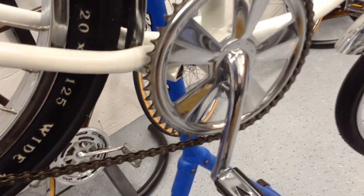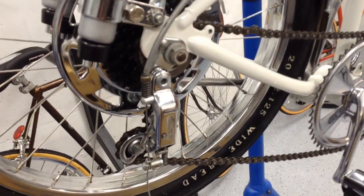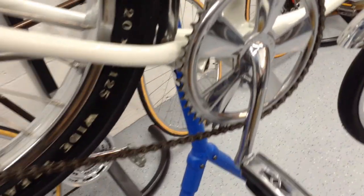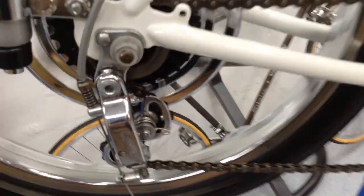When you put an extra layer of chrome on the teeth, it really affects the dynamics of how it interacts with the chain. Along with that, the chain was about one link too long. So I went ahead and sized the chain correctly, and I actually put a different sprocket on here. I just bought this recently on eBay and it just happens to be a 1970 sprocket off a similar bike, so this one actually fit perfectly. Now the drivetrain is working fine — before, the chain kept skipping and jumping off track. Also, the derailleur wasn't set up properly, but she's good to go now.